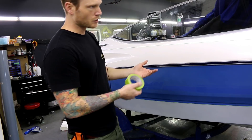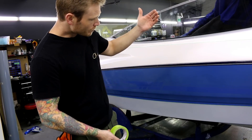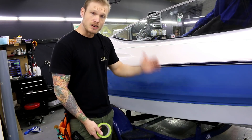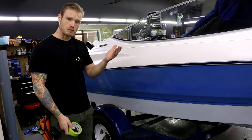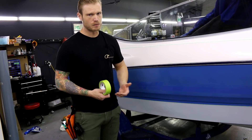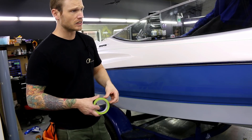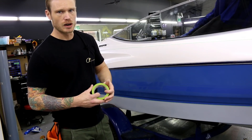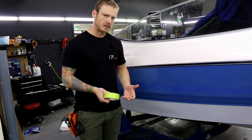If you wrap just the roof in gloss black, the roof will not fade but the rest of the car will — so there's a big difference. There's also a big difference between vertical and horizontal surfaces. Vertical surfaces tend not to fade as quickly as horizontal surfaces. Your horizontal surfaces that are facing the sun most of the time are going to fade the quickest. UV light is infamous for drawing pigment out of things — you'll see it in storefront windows, on other cars, on your trim.